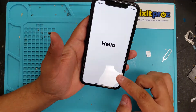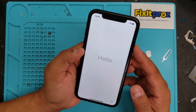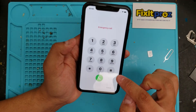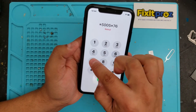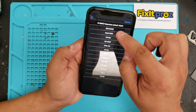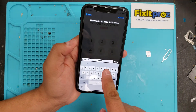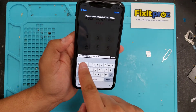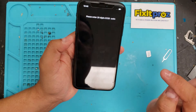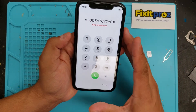You're going to see that it should go to the hello screen. With the XR, to get to the emergency screen, hold the soft button, slide it up, press emergency, and you're going to press star 5-0-0-5, star 7-6-7-2, star 0-pound, then talk. It's going to give you this — edit ICC ID. This is the latest ICC ID; if these videos get older we'll update this in the description, but the latest right now is 0-9-3-5. You hit send, and then it will ask you to hit accept.